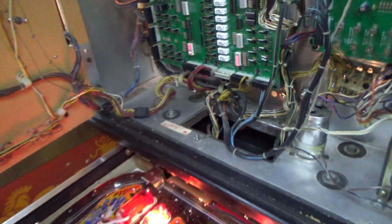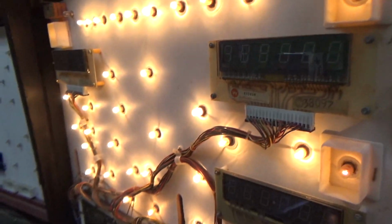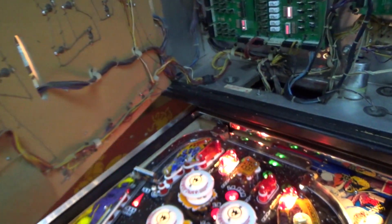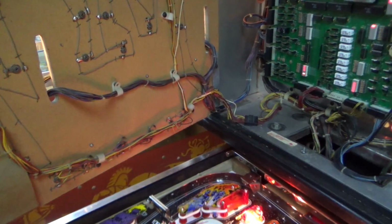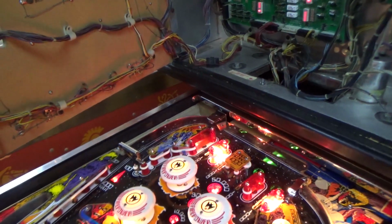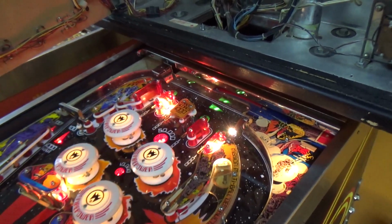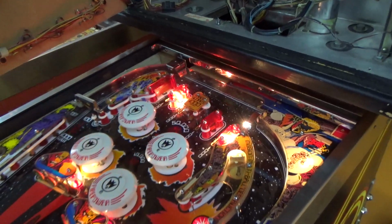So that certainly helps. Now on the back box, all of the lamps are working. The displays are all working except for the master display. The glass is dead on it, unfortunately. If we put in the UDN 6184 or 6118 chip, that display basically shorts the power out. So that glass is shorted, unfortunately. So we can't get the displays completely done, but they're all working except for the master display.